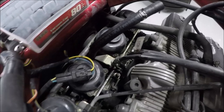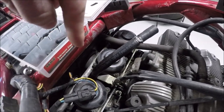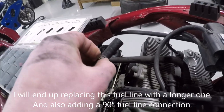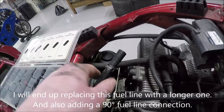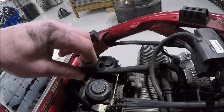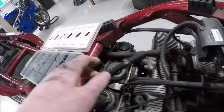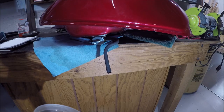If we were going to replace the fuel line, this is it — and the connection is straight down. We should be able to connect this now, and there should be a little clip. The routing on this is going to be slightly different; before it was going in like this, now it's going to be like this. If you had a preformed stock one it's going to be harder to bend. Since I have extra space I shouldn't have any issues.